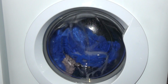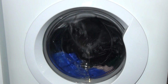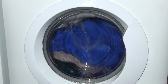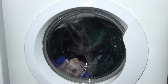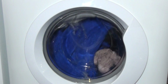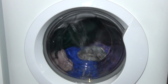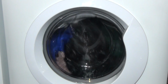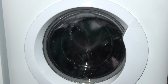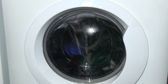So we add water first, a small amount of water, and that fills the sump before they end up putting the powder on, so the powder and the water go straight onto the sump. I like the Aquafall. Although I think it should be an Aquafall and a jet system, which could be really easily done. Because the Aquafall system means the water's going straight on the load and soaking it straight away. It means you can also detect the load quite quickly, actually.